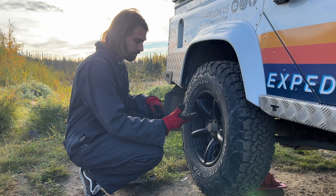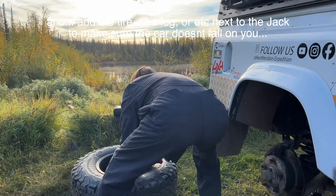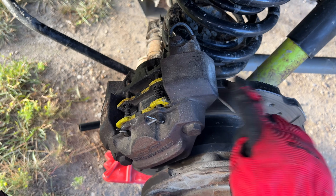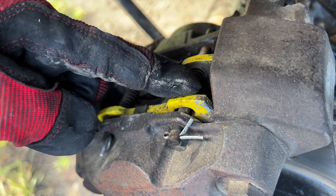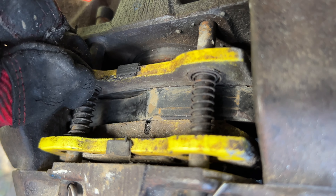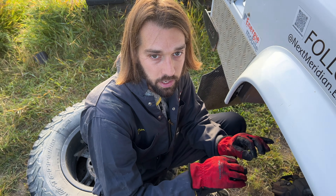The first thing we do is lift the car, remove the screws, and remove the tire. If you look here, these two yellow parts are the brake pads, and this is the disc — the part that spins. I have to remove these two pins, then remove this metal bar without losing the springs inside. Then with a screwdriver, come between the disc and the yellow pad — which is the brakes — make a little separation, pull it out, clean the disc, clean the brake pads, slide them back in, and close everything.